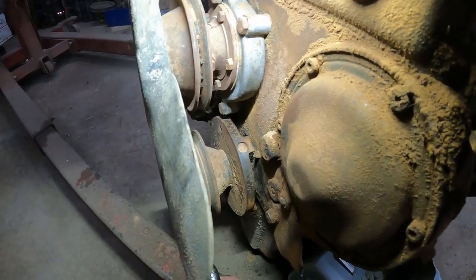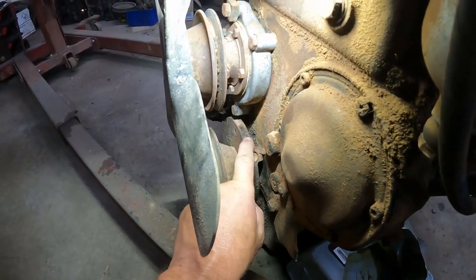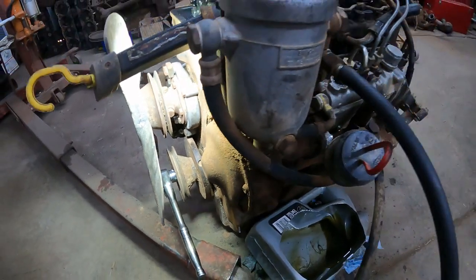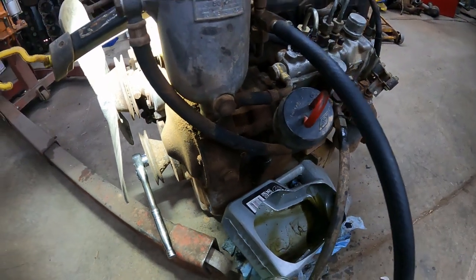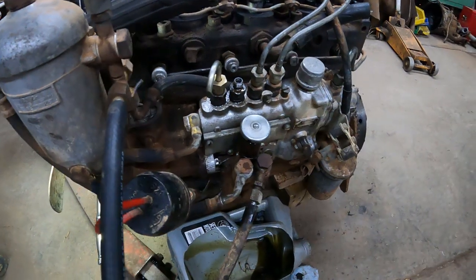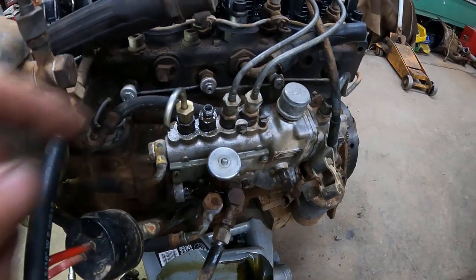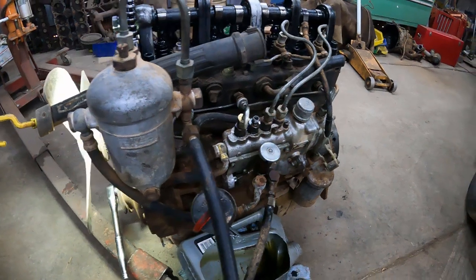But if we want to make it perfect, and then everything that comes on this side is the retard, that's late. Sometimes if the engine loses compression, some people go a little higher, 28 degrees, but I kind of recommend listen how it runs. But 26 on the 621 is the right setting. I hope this shows it a little better than on my other video.